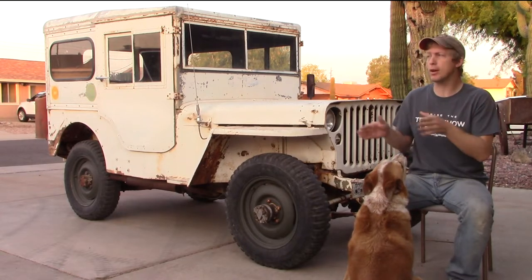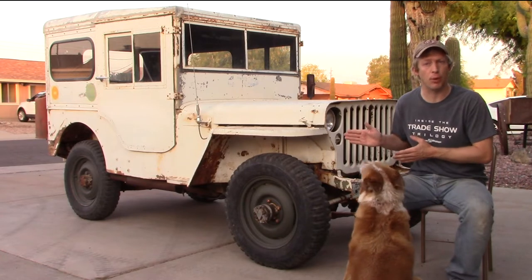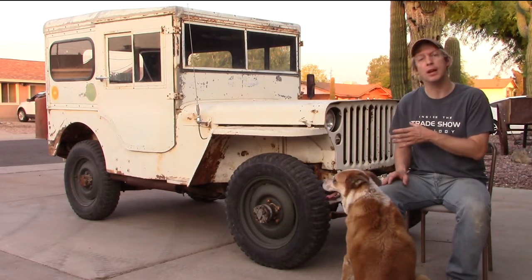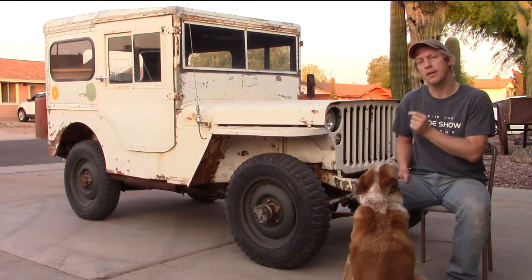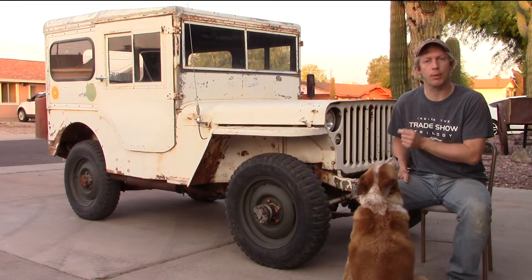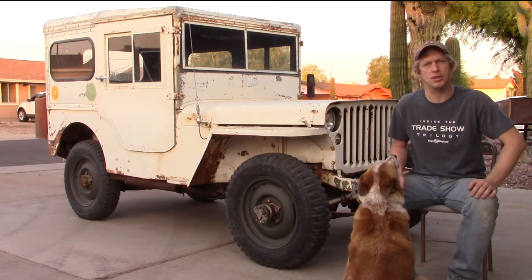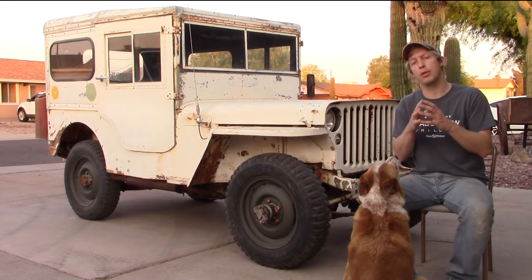And today we are going to be diving into this 1943 Willys MB project. The first and most important thing I want to do is get this running. And the biggest hiccup in getting that happening is the need for a replacement ring gear. So obviously it's having trouble starting. We're going to go in, we're going to replace the ring gear, and that's going to involve pulling the transmission